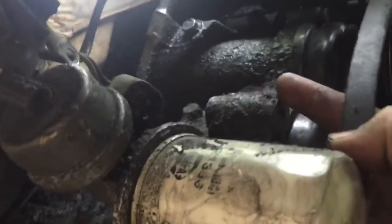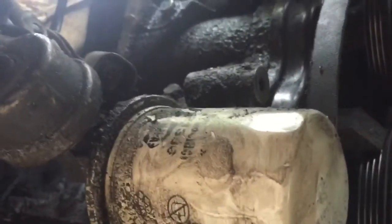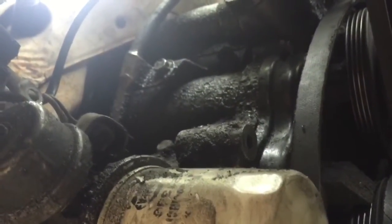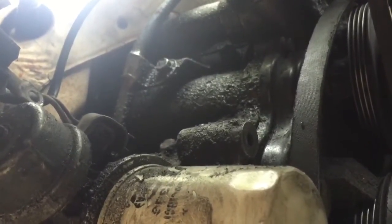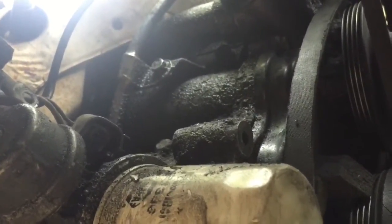It's a bit of a pain to get off — you've got to shake it. There's a little T-post right there; you have to slide the bottom housing of the alternator off. You just have to crawl up under the car and wave it around till you get it off. Make sure you've got your car jacked up with jack stands and be safe. To put it back on is the reverse of the process.